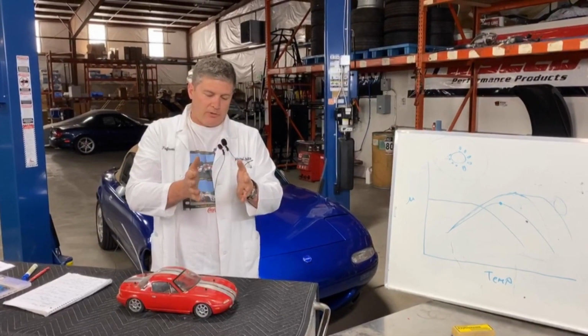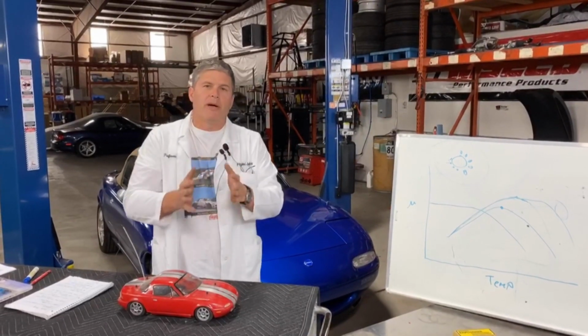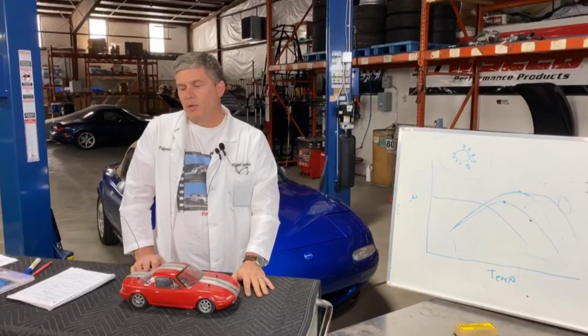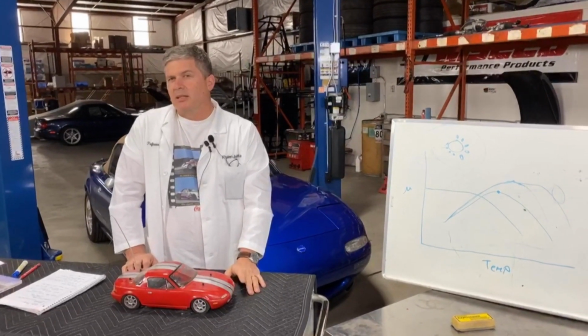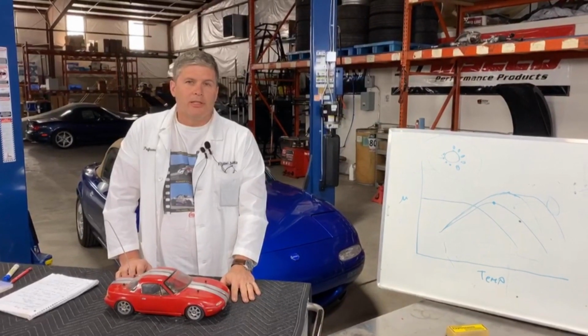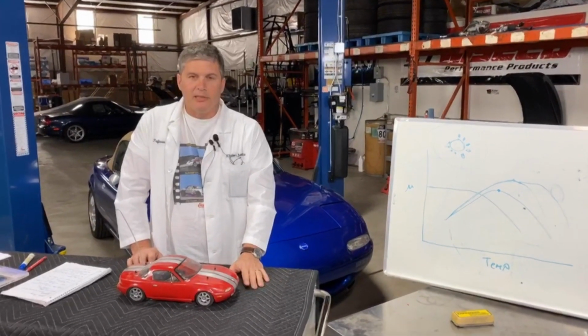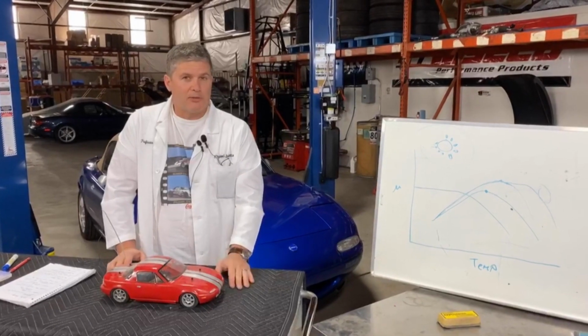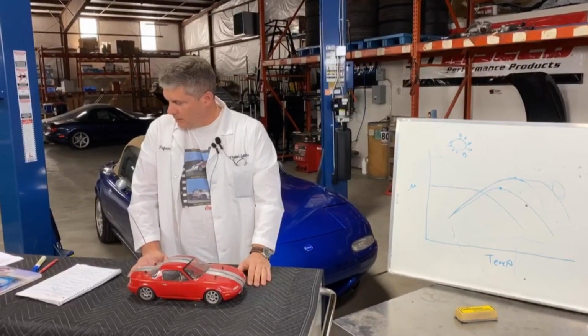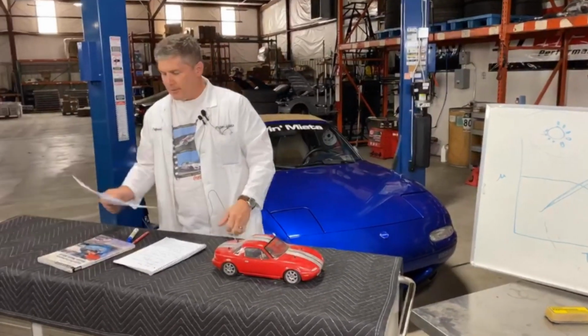And so now, of course, you've got uneven friction and you get that whoop, whoop, whoop through the pedal. So that's usually what brake fade, or what warped rotors are. StopTech has some great white papers on this stuff by a fellow named James Walker Jr. He's got some books out there as well, but they're pretty good reads if you want to read up on the basics on things like pad transfer, bedding brakes while you're doing it. It's a good resource. I'm going to go to the questions here, see what I have.